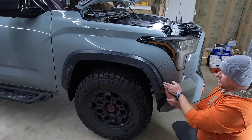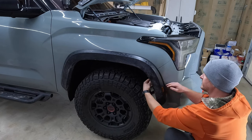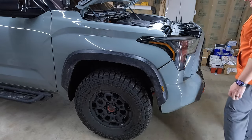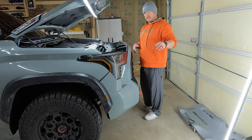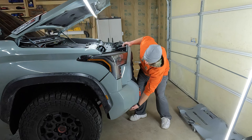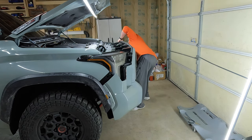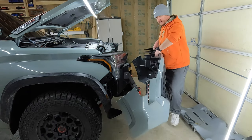Bumper is free from the truck. Get your hands up behind the fender flare, get your fingers in between the fender liner and the panel, and you're just going to pop it straight out. You can see that frees up this whole area. Same thing on the driver side. Before you actually take it off, make sure you know where you're going to set it down — painted surfaces, you want to put down something soft. It is now free to just pull straight off the truck, supporting it as you go across. If you have two people to do this, it's obviously much easier.